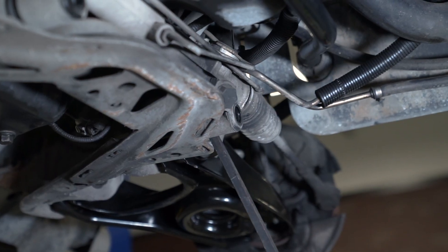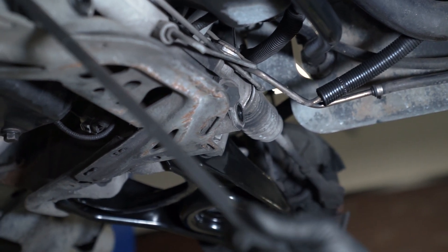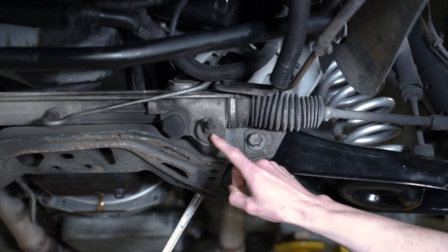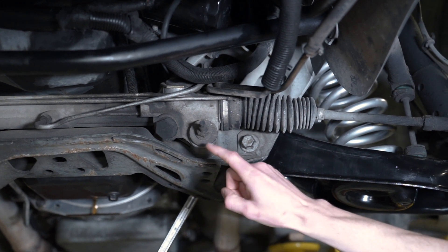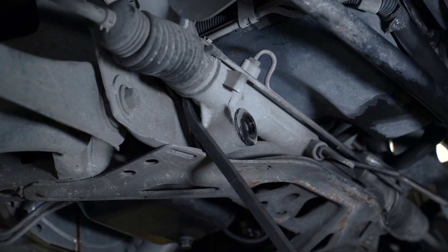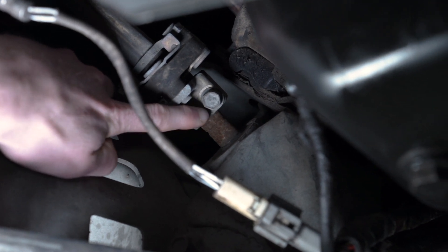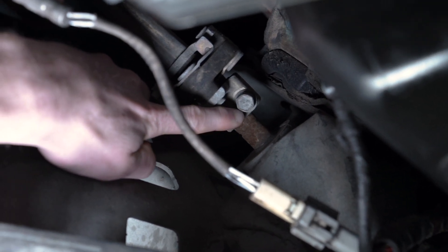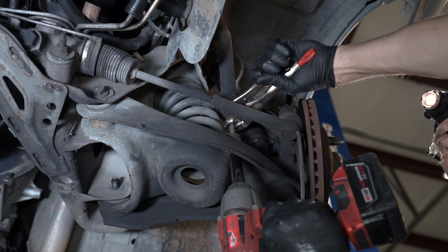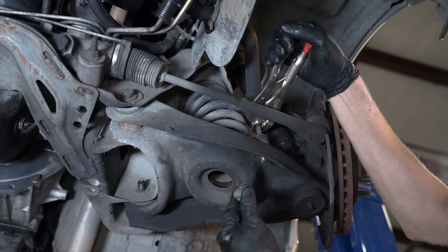If you own a 96 to 04 mod motor car, you will need to bring the steering rack forward to remove the frontward lower control arm bolts. Locate the rearward 15 millimeter bolt head and the frontward 18 millimeter nut retaining the steering rack to the K-member. Remove both nuts and washers. Use a pry bar on the passenger side of the steering rack. If needed, you may also have to remove the bolt on the steering shaft to steering rack to allow for proper clearance on the driver's side. Place a pair of vice grips on the sway bar end link flat. Loosen and remove the lower retaining nut with a 15 millimeter deep socket. Go ahead and remove the bushing, then remove the vice grips.